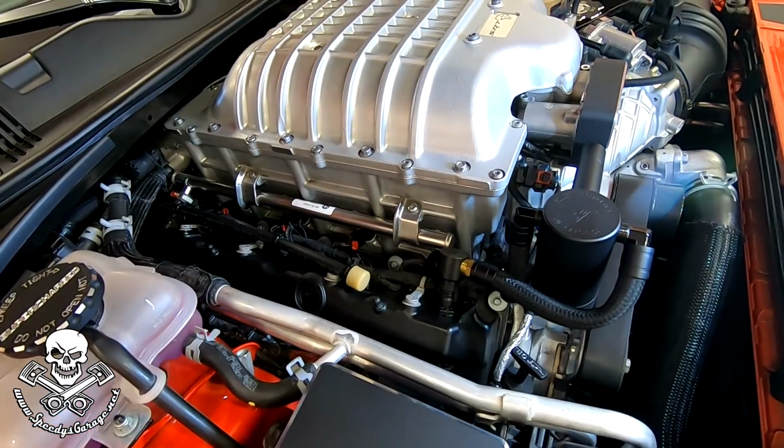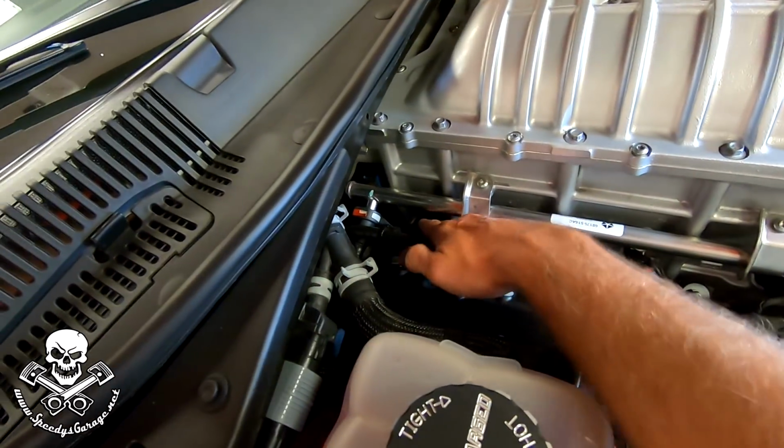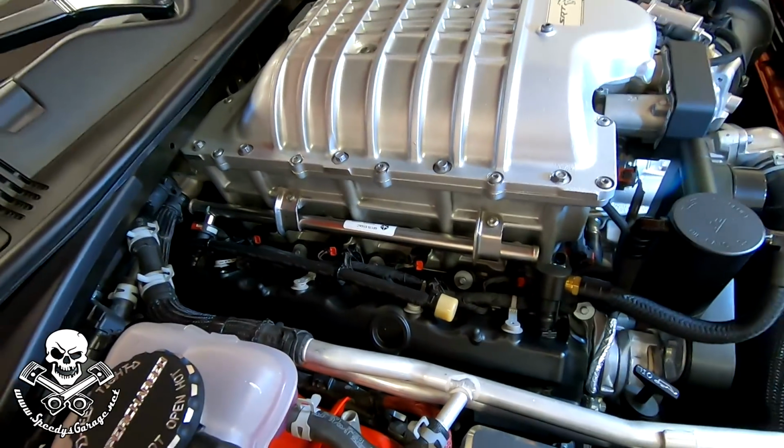And if you're wondering if I checked the simple stuff first, like a loose injector wire or a vacuum leak, yes, I did. So after I changed the front O2 sensors, I swapped passenger side to driver side and driver side to passenger side. I was expecting the code to follow the sensor, and I would end up getting a code on the driver side instead of the passenger side. However, that didn't happen. The code popped again within 50 or 60 miles, I would say, and again, it was on the passenger side. So that told me that the front sensors weren't the problem.